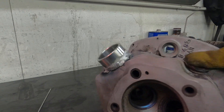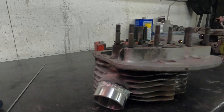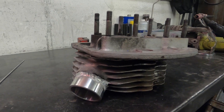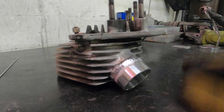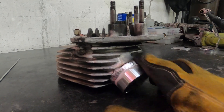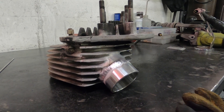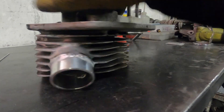Here's the point now where you can either sit there with a Dremel and sand it all down really nice, but I'm not going to bother grinding it down. What I'm going to do real quick is just re-bead blast it so everything matches. I'll leave the weld there — I'd rather leave it anyways for a little extra support. And yeah, that's replacing a panhead exhaust spigot.